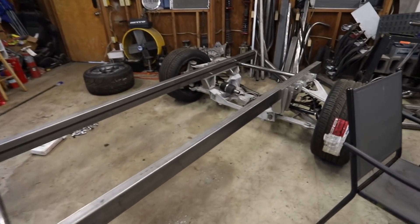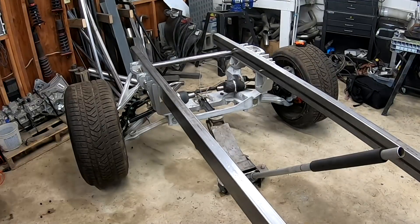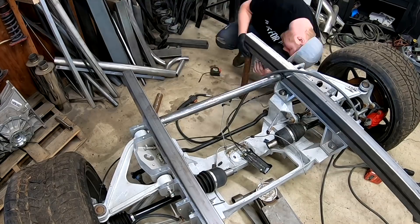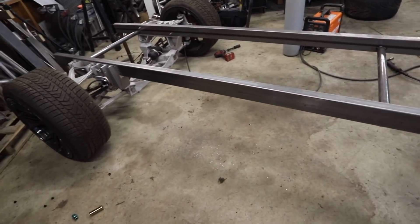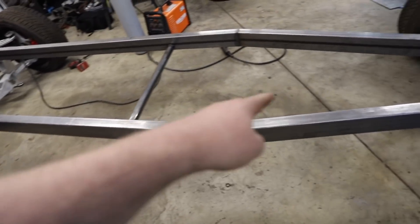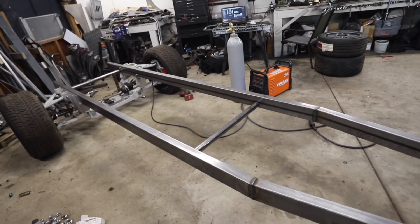Moving to the back, we're actually too low — about 21 inches — because we don't have the wheels on yet. We'll get those on and see what adjustments are needed. The next piece is the bottom of the driver's box — it sits three inches off the ground and runs the whole distance of the car, mirroring the frame rails. I thought of a really cool thing: I could 3D print some pieces that would save me a bunch of time making these things accurately. So let's jump into the computer and 3D print something.